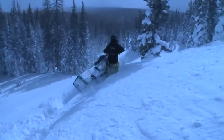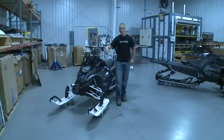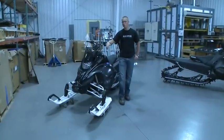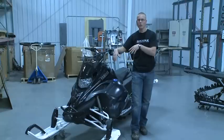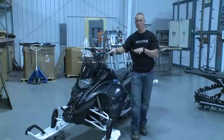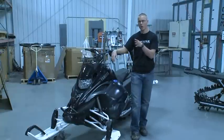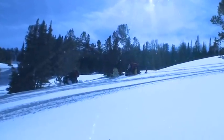When we redesigned the a-arms and started riding — the first four or five rides, the first couple hundred miles — we had to regain that confidence. It took a while because we were putting ourselves into situations you normally wouldn't with a Nitro and seeing what it would do. For example, side-hilling and sliding into a tree, with the skis sitting flat on the snow in an off-camber situation. Normally you'd pull the machine back, but starting from that spot was really difficult with stock setup because you weren't sure if you could pull it up into a side hill or if the back end would wash into the tree. So we were getting into those situations to see what the arms were going to do.